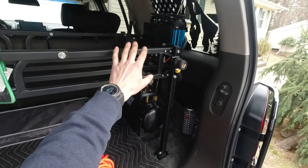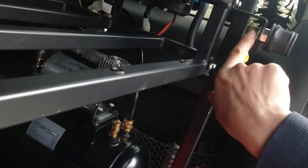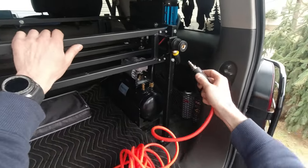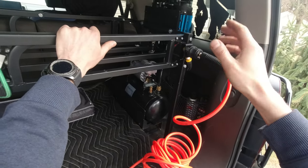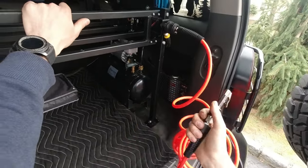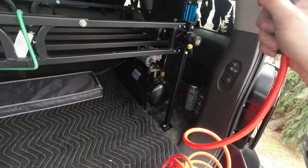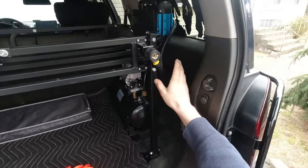The compressor is installed. We had to MacGyver some stuff — we put a big washer over here and this fitting, but it all worked out in the end. The switch is on, and if I connect this it starts working, and then the pressure switch kicks in and shuts off the power. Now we can connect it to the tire, fill up the tires, and do whatever we need. To disconnect, just hold this and push it back — just be careful, it has a lot of air pressure in there. This is done.